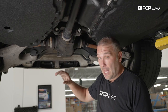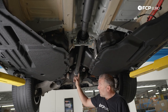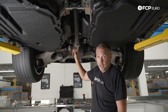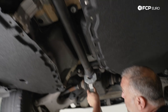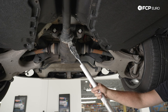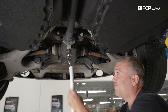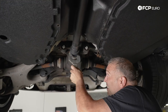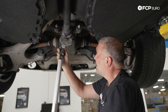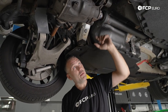So with the drive shaft properly secured with that center lock, we're going to use the 50 millimeter crow's foot wrench from All German Auto to break this nut free. We'll show you how this interface works — leverage is your friend here. I went ahead and kept turning that 50 millimeter nut in the clockwise position as I was facing the differential.